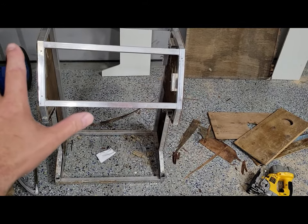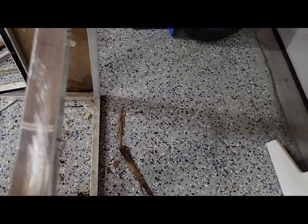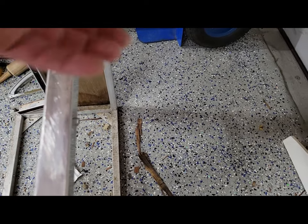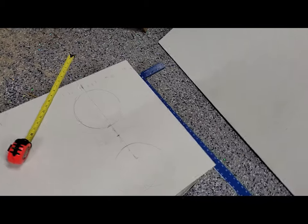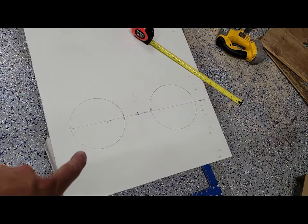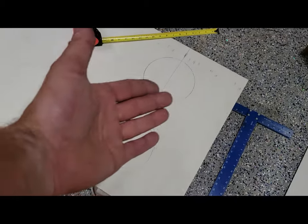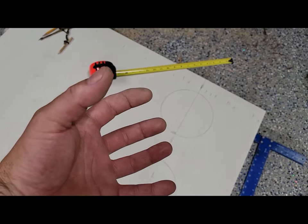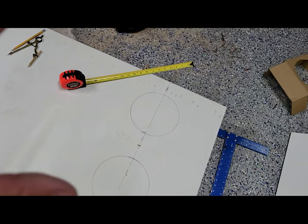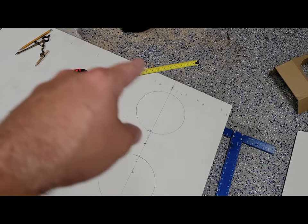Moving forward, I got most of the old junky wood off it, with the exception of the sides. The back was able to push off — the staples are still in there but I can pop those out with a flathead screwdriver. Right now I'm working on the front piece, which is also serving as the speaker box — it will utilize two eight-inch subwoofers. I've set them just high enough so I can get the lower bracket bolts to mount this back onto the floor, and kept them up high enough so they won't sit in moisture. I'm going to build a box onto the back of this piece of wood. We're going to use a nail gun, nail this thing together, and use liquid nails to seal all the way around the inside to keep it sealed.